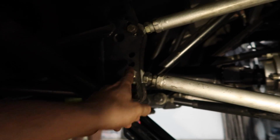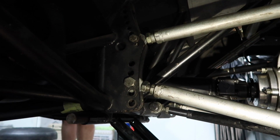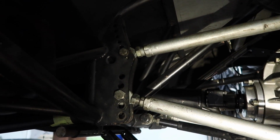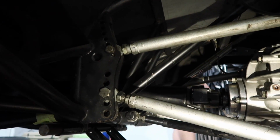So Jason said, and we knew this for a while, where it was separating quite hard, but it was working fine, so we weren't going to mess with it. So that's what we're going to do today: remove this bolt and shorten this up to match this bolt hole. That should keep everything the same, just lower that anti-squat value. Ben, it bumps the instant center forward, doesn't it? Moving that bar down. Yeah, it gives us a longer instant center.